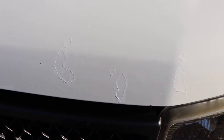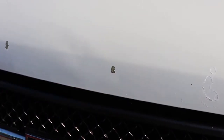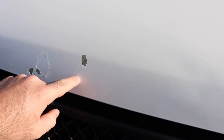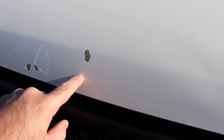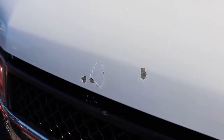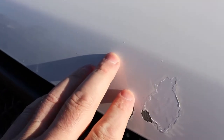I can't really tell how well you can see it, but there's a lot of damage to the paint on the hood here. There's actually a dent in the hood here, and there was a little rock chip that started here and the water went under the paint all the way down to here. I could see a little line, so as I scratch on that it's going to come off. I started doing some repairs last night. I should have done this one up here with a toothpick — using a brush was a poor choice because it just went all over the place, and it's had many repairs in the past.